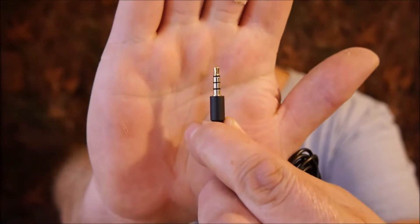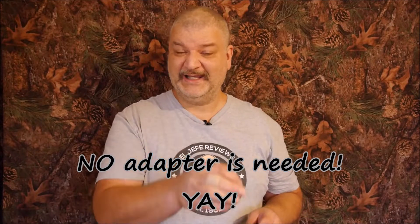The 3.5 millimeter plug has three little black rings, which might lead you to believe it's a TRRS system. But when I experimented and put on the adapter to turn it from TRRS down to TRS, it didn't work in my camera. So I followed the instructions and plugged it straight into my Panasonic G6 with the switch set to 'camera' — it worked beautifully. Then I put it in my S7 with the switch set to 'smartphone' and did a quick test — worked beautifully as well.